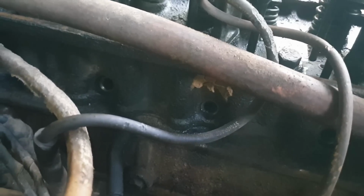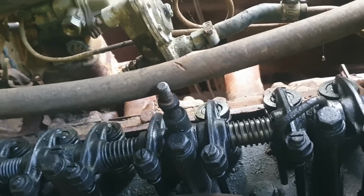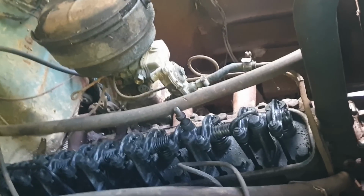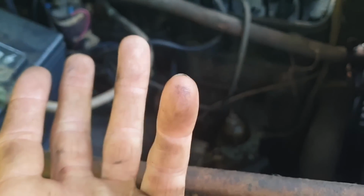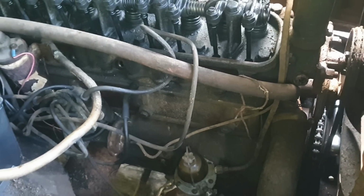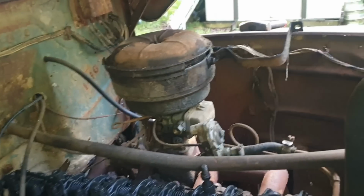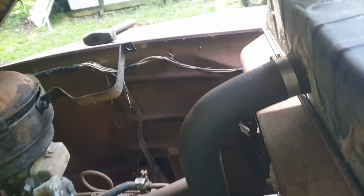So I have looked in that cylinder, and I don't have my bore scope with me, but just shine a flashlight in there. There was a little bit of rust on it, and when I had the spark plugs out, that one had just a tiny bit of rust. I'm pretty sure that's where it's stuck. It's on number 2, because that's the only part of the engine that was open to the outside atmosphere through the exhaust, and moisture could get in it. Just like all the other valves are closed. It's an oil bath air filter that keeps the intake side completely sealed off with oil.